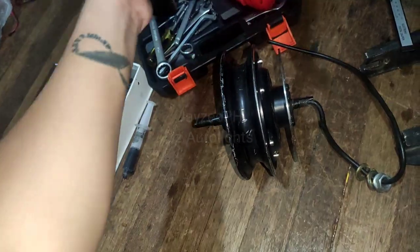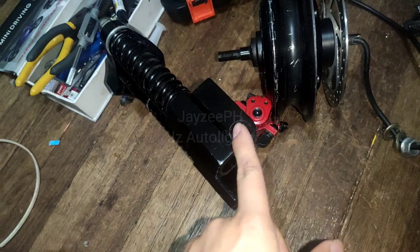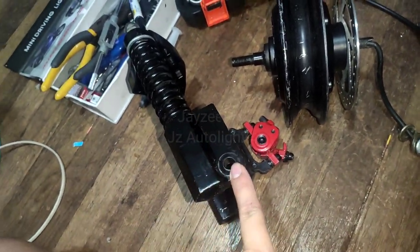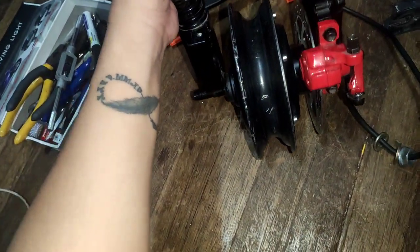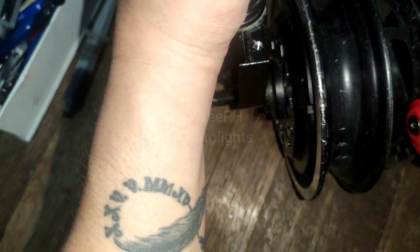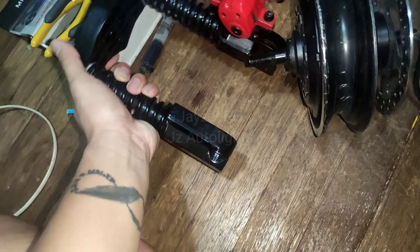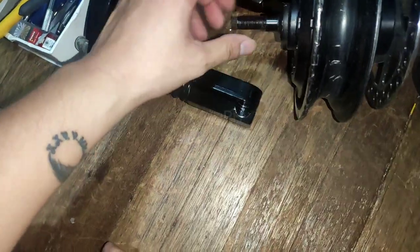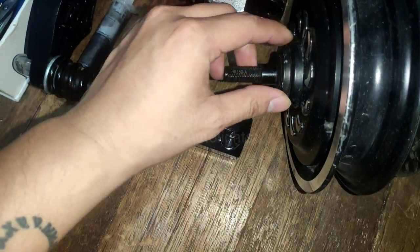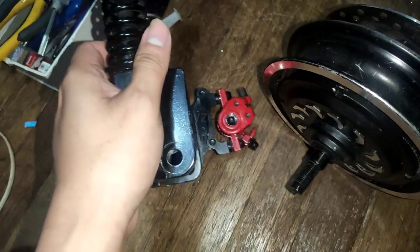As you will see here, because this is only a hole, if you fill it right there you will only have a small clearance. So we'll have to grind this part a little bit so that it won't touch this part of the hub. So we're going to cut here.